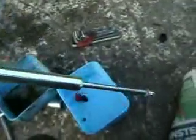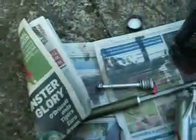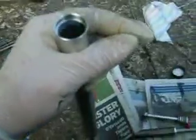Well, they're telling you the wrong amount of oil on the website, because with that amount of oil in there, I don't know if you can see down there, the oil is a very long way down, and the top TST travel control doesn't work. And there's a big amount of air in there. So I'm going to put some more oil in. Now, on the RockShox I've serviced with this type of cartridge, you normally fill it full and try and avoid getting any air bubbles in, so let's see if that works.